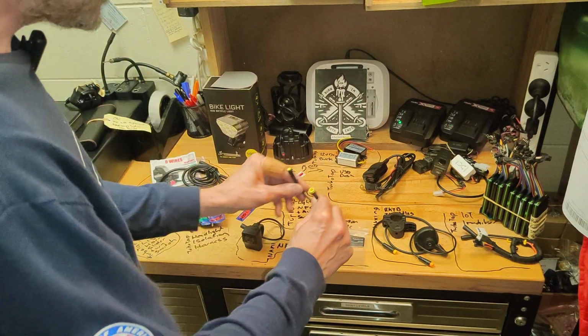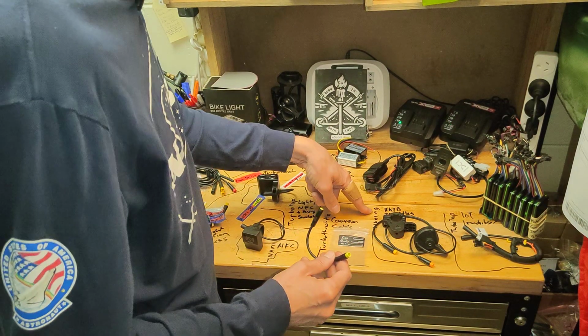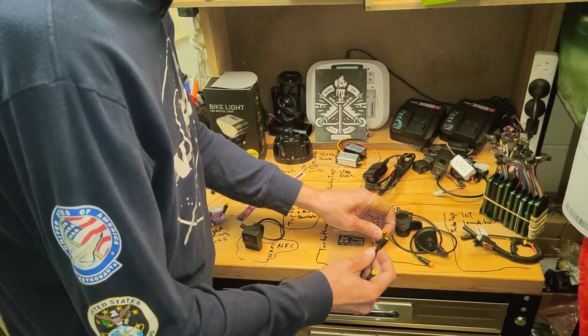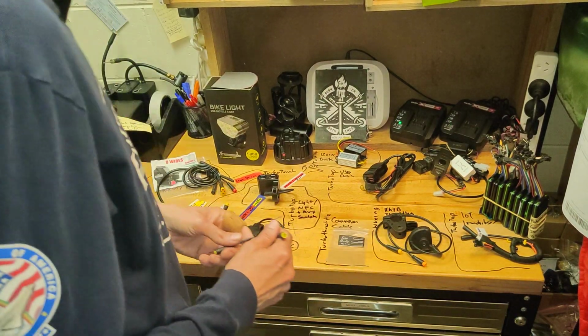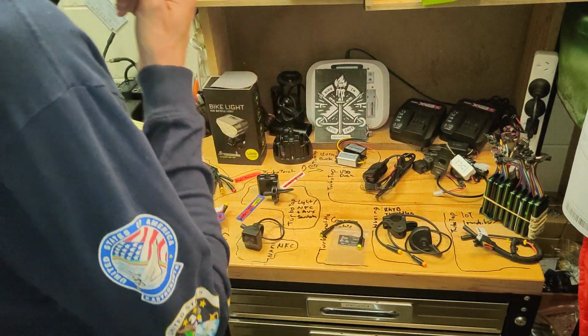The throttle conversion cable. Okay, so this is the turbo throttle, which allows you to connect your standard sort of Wuxing e-bike throttles, the rapid KT bolt standard, which is different to what's used by NAMI and Cabot systems. So that just plugs straight in there, and that goes into your wiring harness on your NAMI, and you can change your throttle with a plug and play conversion. Just swaps those wires around internally in there.